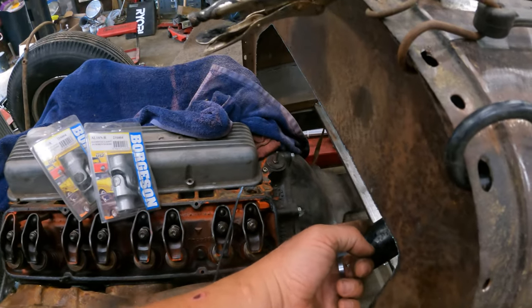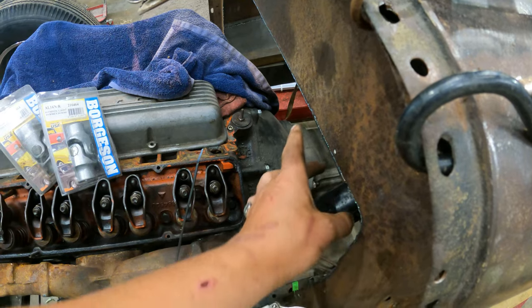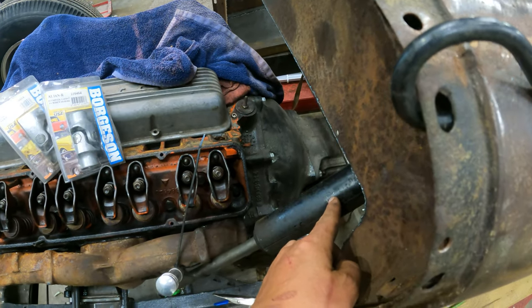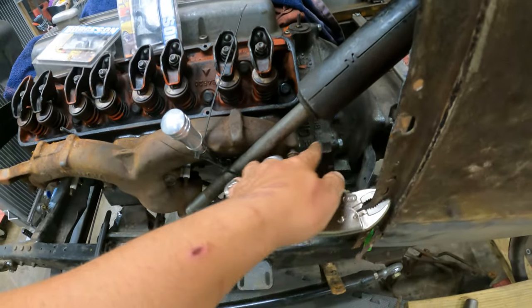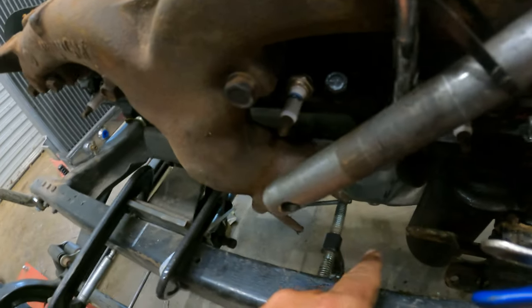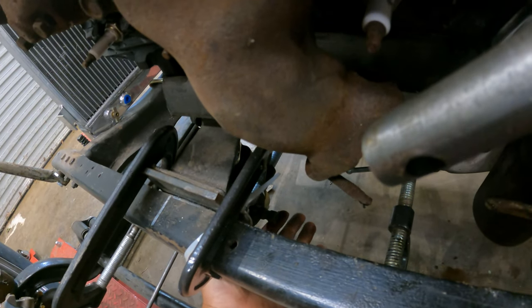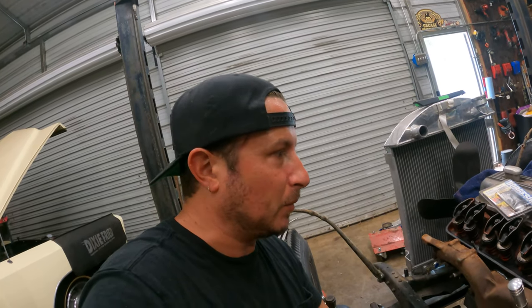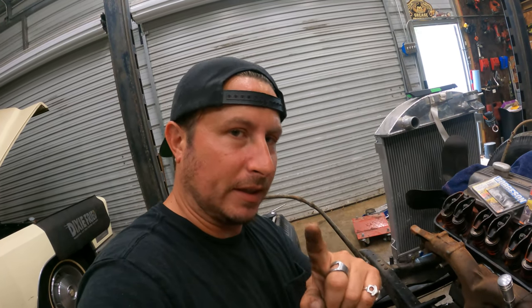So what I'm saying is, I think we've learned what we need to learn. And if I trim the steering column mast here, we'll be able to attach it to the firewall with some kind of brackets that we weld on, so that stays stable. And then we can put a U-joint in here, something like this, so that we can drop the steering shaft down under the exhaust, and then just barely by the inside of the exhaust to right here. Probably three joints, which is not really what I want, so I'll require a support bearing, but we can make it work, I think, which is very important.